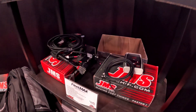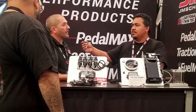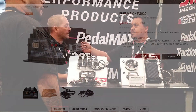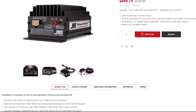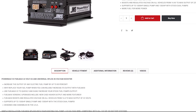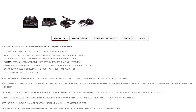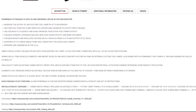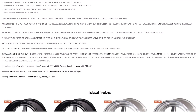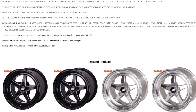Can you tell me a little bit about the universal version of the FuelMax? The universal FuelMax can be done in either a single channel or dual channel — single pump or dual pump. Basically it's a voltage booster that takes the actual battery voltage and increases it up to 22 volts depending on how you want it. It has a ground activation or a 5-volt activation, and you can also do a time-based ramp or a ramp by voltage — 0.4 volts, 0.8 volts, 1.2 volts — from battery voltage to its max output.